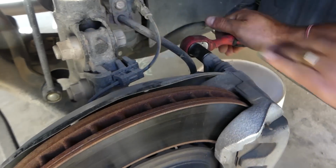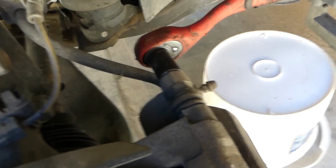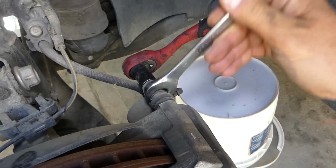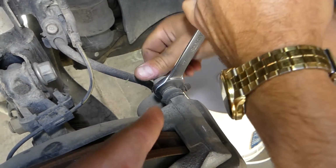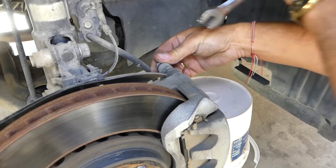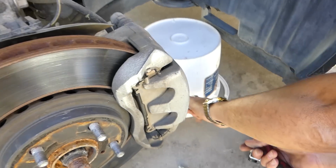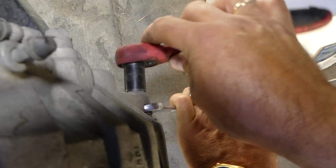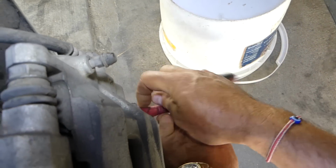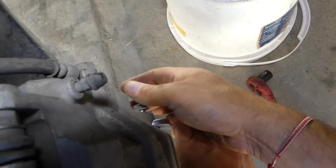So now on the back side we're going to remove the bolts, and right here you have to hold them with a wrench as well on this side, because otherwise that glide will start turning. And those glides are removable, so you can remove and grease them, inspect them, especially if you live in a state that has more snow, rain. Here in California we don't get any of that. There is one more on the other side. Okay, just like that.